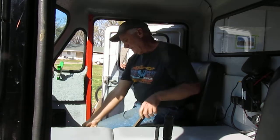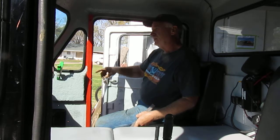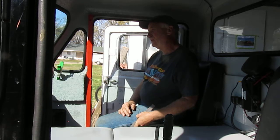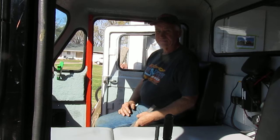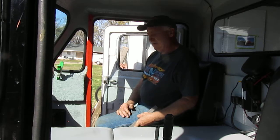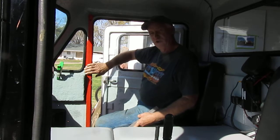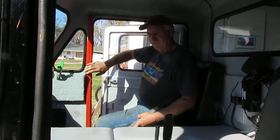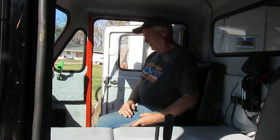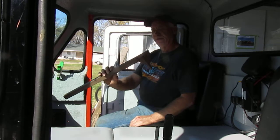And then the next tip I have is for what type of metal to use. You could use some 1-inch, 1.5-inch mild steel from the hardware store, Home Depot, whatever. Stuff's not very strong, it bends easily. Of course, aluminum's not going to be very strong at all. I've seen that used, and I'll see it bent where somebody has been grabbing, using this doorway to help pull themselves into the car. And what I recommend using is good old bed rails.